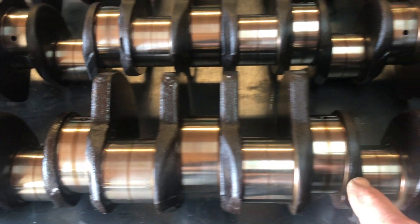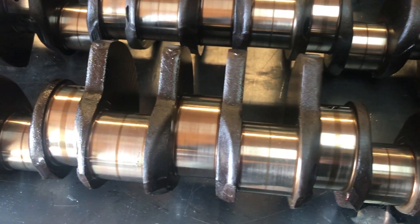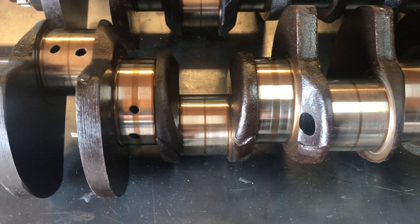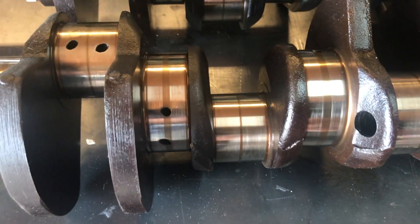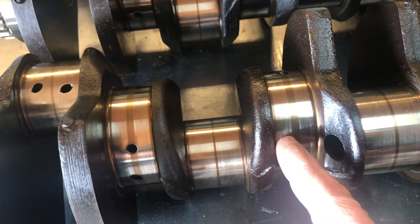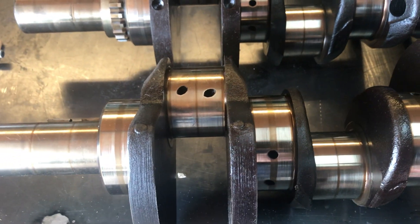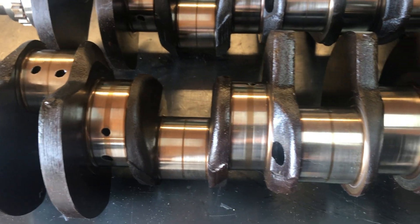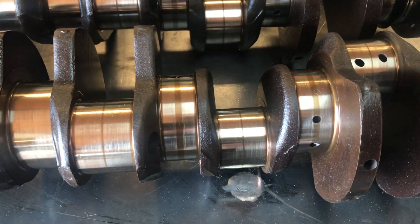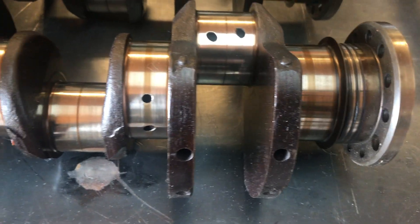The crankpins are the ones that the connecting rods attach to. In the case of this crankshaft, while it appears to be in reasonably good shape, some of the main journals — this one right here in particular — the finish is kind of rough. You can run your fingernail over it and feel some pretty significant roughness. Plus, all of these journals are just a few ten-thousandths of an inch smaller than they really ought to be. So we can eliminate crankshaft number one right away.